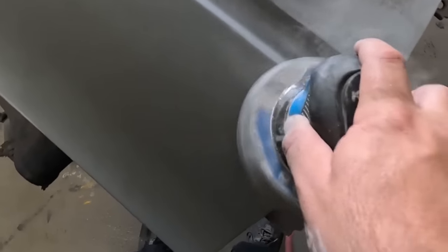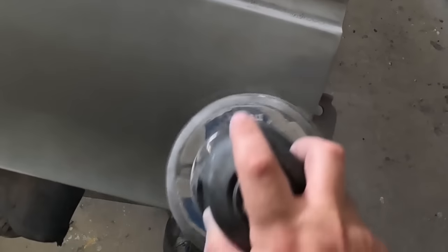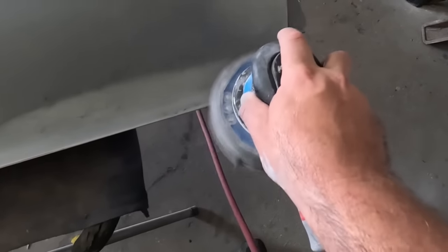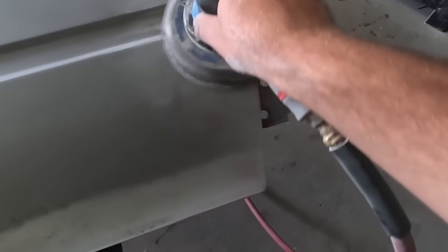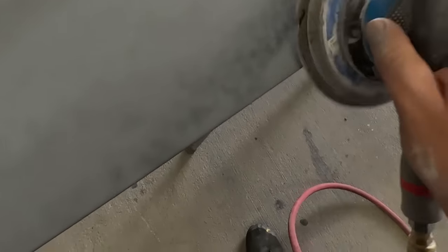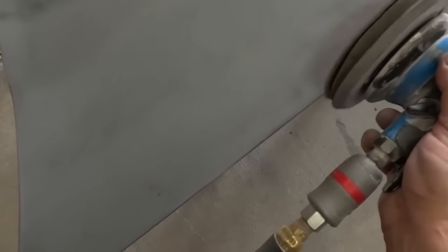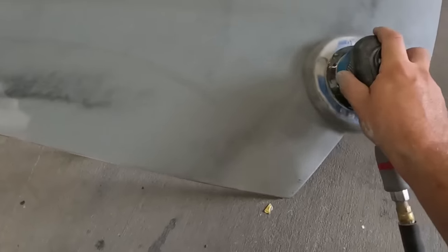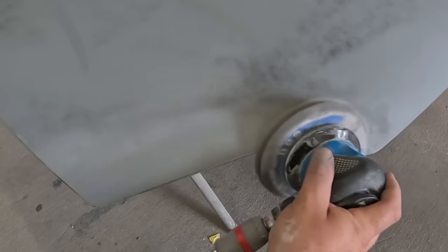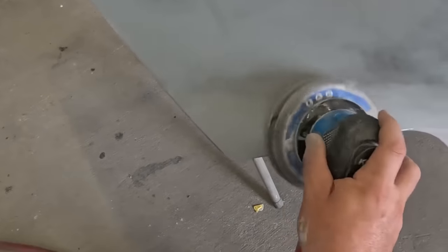Cut-in areas usually are not the easiest to sand, so you can use a combination of maroon scuff pads, gray scuff pads, or fold over the paper in order to get into the areas that are hard to reach. I like to always start with the cut-ins on a spray job because this is a good practice for my color and getting things down pat before the actual vehicle is sprayed.